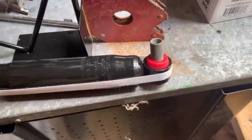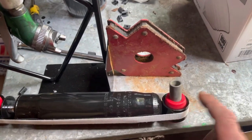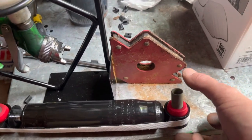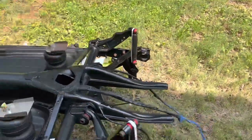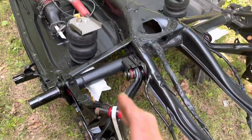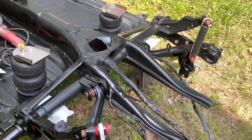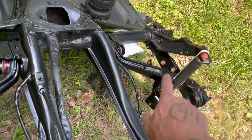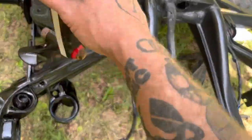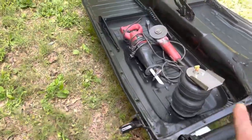The new shocks in the Air Cooled kit require these little spacers or sleeves to be pushed into the urethane bushings, so that when you tighten the bolt down it doesn't collapse them. At this point I have everything rough installed and tightened down - the suspension moves but it's a little stiff because I don't have any grease on it. The only thing not completely mounted is the shocks on both sides - I've got the top in but not the bottom, because I don't want them in the way while I'm cutting these bump stops off.